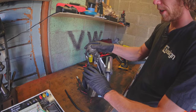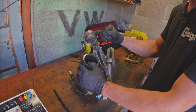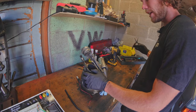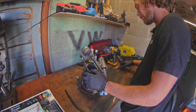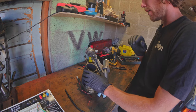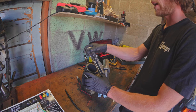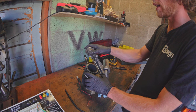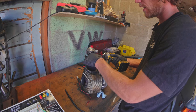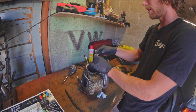So here is our culprit system. I feel like the combination of lack of adequate vacuum from my vacuum pump and the wrong amount of throw in the actuator together made this not work very well. But while having it on the car, it made me appreciate that nothing is really a silver bullet. I was actually pretty stoked on my Arduino setup, especially because me and Dave spent so much time working on it. I think in the interest of what I want to do more — having my Arduino computer do things rather than mechanical boost control — this is coming off.